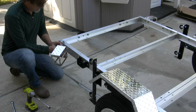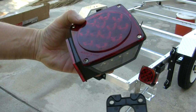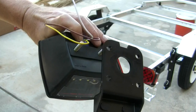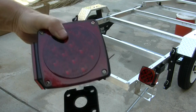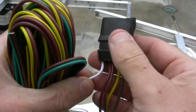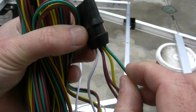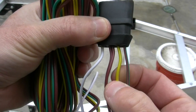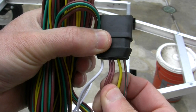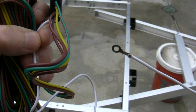The light with the license plate light at the bottom and its bracket goes on like that — not in these two holes. You'll see it has to go up through the frame first, and then it goes this way with the red light out. The wiring is simple enough: green and brown is right stop and tail light, yellow is left stop and tail light, and two browns are running lights both in the front and the rear running down both sides. The white is the ground, which is short, and they provide an eyelet to screw that into a good ground somewhere.